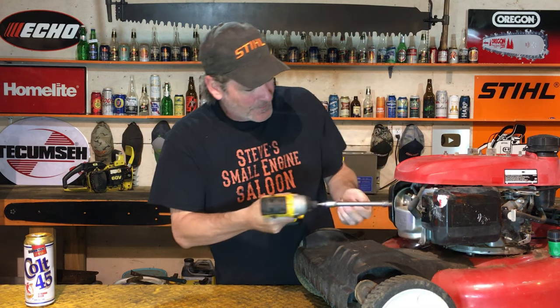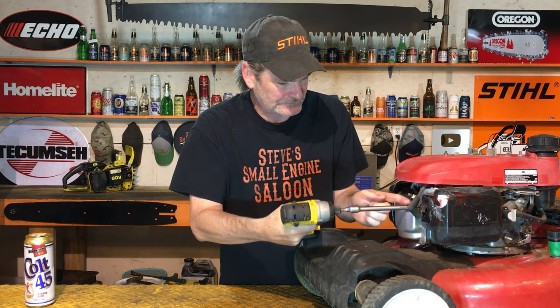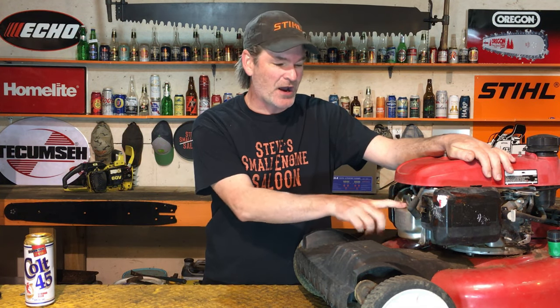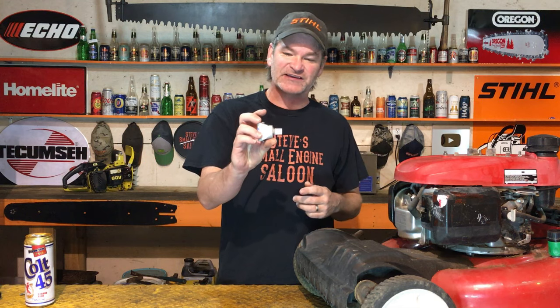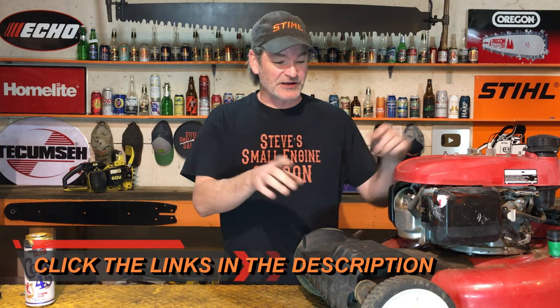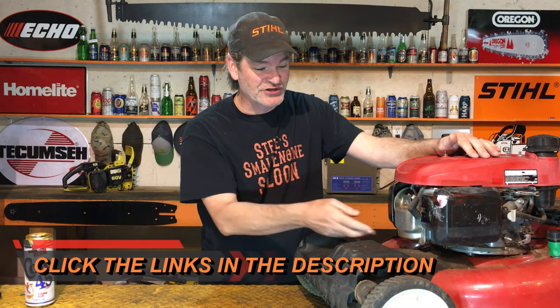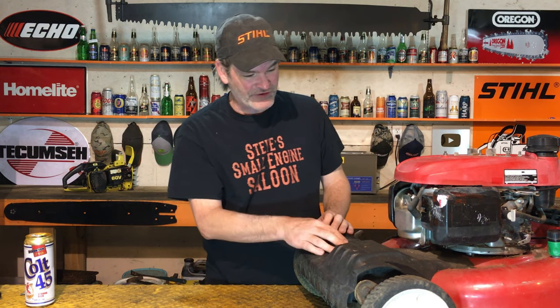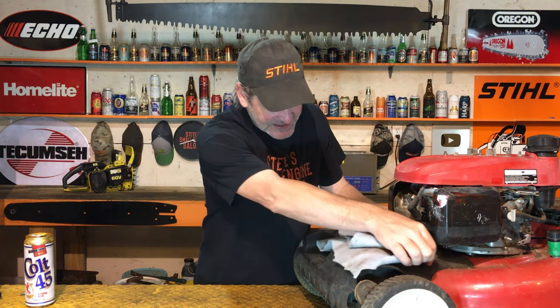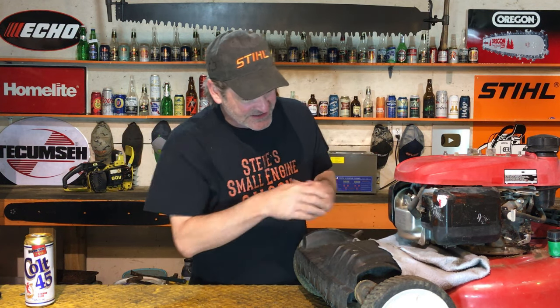There are four bolts — put those aside. That cover is glued on; there's not a gasket behind that valve cover. It's glued on with gasket-making sealant — Honda calls it Honda Bond. I have a link in the description for that. When we pull it off, there's going to be some residual engine oil in that valve cover that will come out, so I usually just take an old rag and stick it underneath there so it doesn't make too much of a mess.